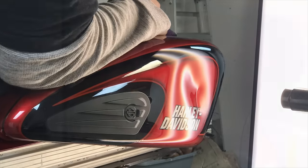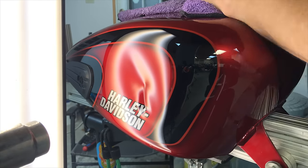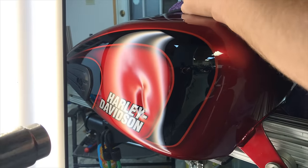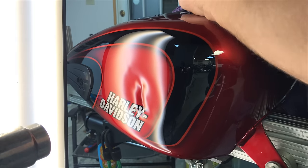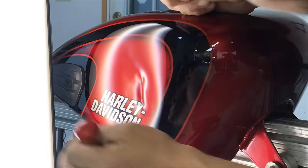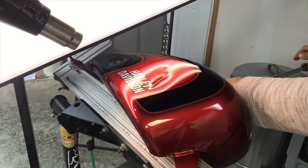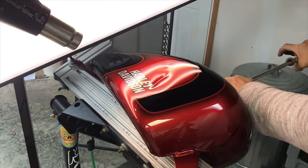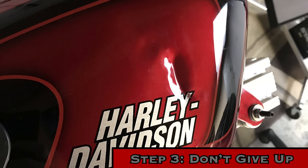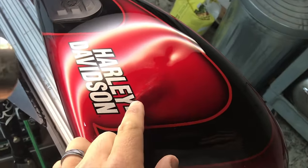We're now down inside the tank with our paintless dent repair tools, using slow pressure to the backside of the metal and slowly shaping it back out, using a light as a reflection. We're also using a heat gun because of how deep and sharp that crease is — without doing that we'd risk cracking the paint. We spent a fair amount of time using a hammer and knockdown, taking down the high spots around the center of the damage to allow us to bring the center of the dent back up.